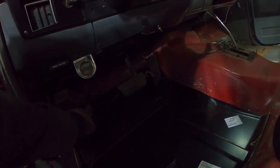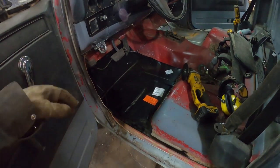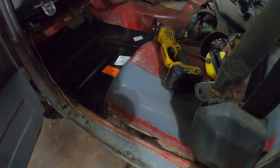I'm going to mark it, and I don't know how far on the toe board up I'm going to go. And I'm going to pick the gas pedal out. Unfortunately it's still pretty rotted up on the side, but whatever - it's going to fit, it'll be just fine. And then I can just splice in there. Yeah, we should be good. A little bit of seam sealer.